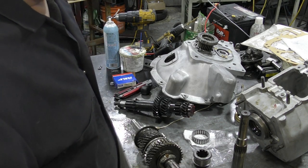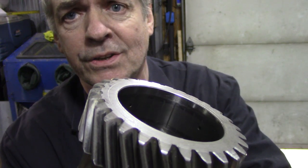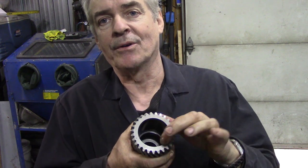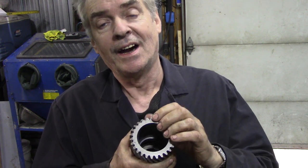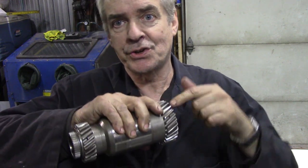One of my big problems is this bit here - the bearing goes on this ring. If you look carefully, you can probably see the bearing has chattered in here. If we put all new parts back in with this chatter, those new parts aren't going to last very long. We had a word with JP and he seems confident he can machine this out - grind it out because it's hardened - and then from SKF you can get a sleeve to press in, then re-grind it back and drill the holes through.